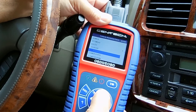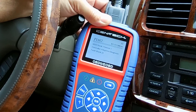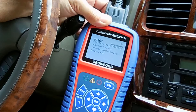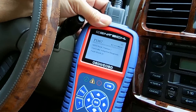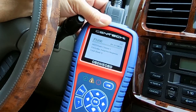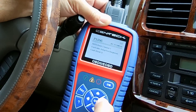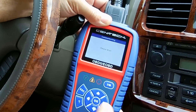Let's go through all — it said a code was found. My check engine light goes on and off while driving, and that's a common symptom of a faulty oxygen sensor. There are four on this vehicle: two on bank one — one side of the engine — and two on bank two. Here it says bank one sensor one is faulty. The code number is P1166 — bank one sensor one. That's all the code, so let's hit escape.